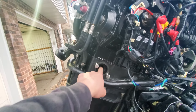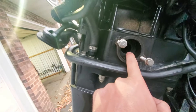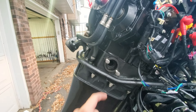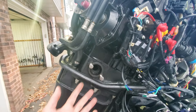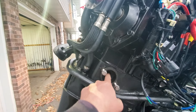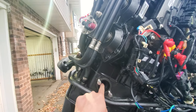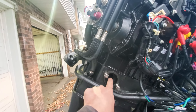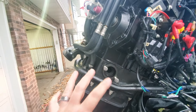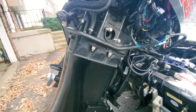There are some other videos showing how to install this properly. There's a water passage here and here, and there's a gasket right in here — there are a lot of ways you could drop that gasket down into your exhaust plate and lose it forever. When you install it, take a screwdriver or a dowel rod, put the gasket onto the screwdriver, push it all the way in until you hear metal go 'tink,' then press the gasket into place while maintaining pressure. That way if you accidentally push it through, it's still on the screwdriver and you can fish it back out.